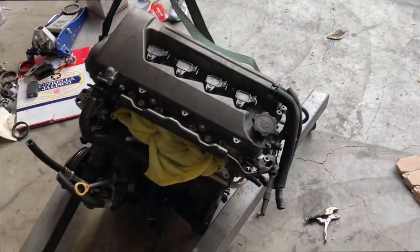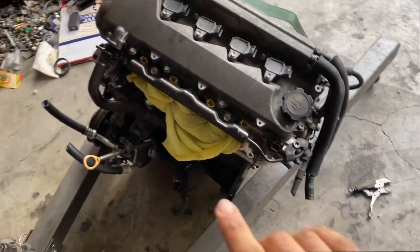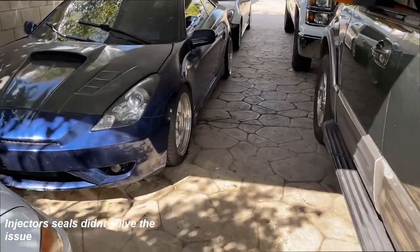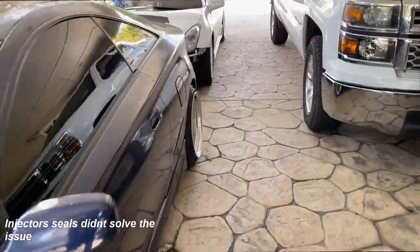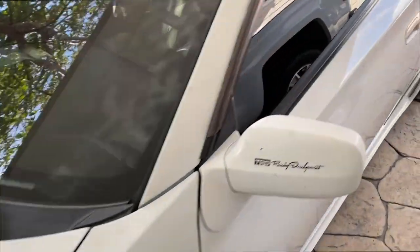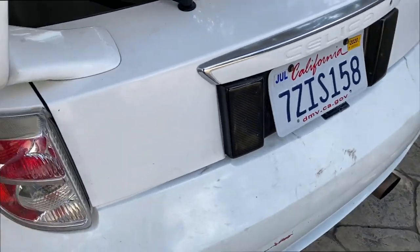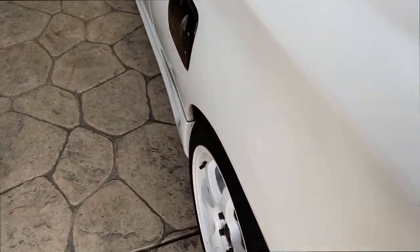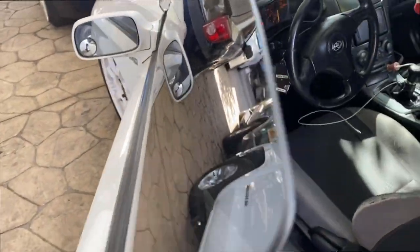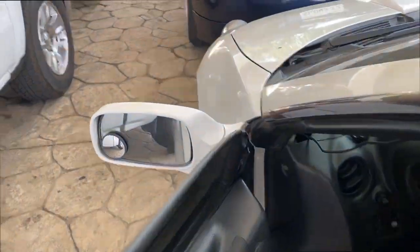Having a leak on my girl's car, and I think it's the manifold that's warped. We're taking the stock manifold from this one, and we're probably gonna put it on that car, but we're gonna go to my friend's shop, do a smoke test on it, and make sure it's coming from the intake manifold. I did try to reseal it. It does have a new gasket, so yeah, I'm gonna go right there real quick and see if we can fix this lean code. That's all that's missing.